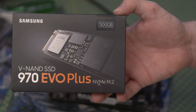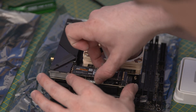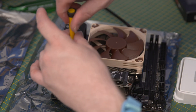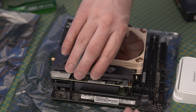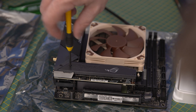This one has write speeds of up to 3200 megabytes per second and read speeds of up to 3500 megabytes per second. Insert the M.2 drive into the slot making sure it lines up with the screw hole nice and flat without bowing or being on an angle, then just screw it into place. Now place the M.2 heatsink back, making sure to remove the cover over the sticky tape that will help hold the M.2 drive in place, and screw the heatsink back into place.